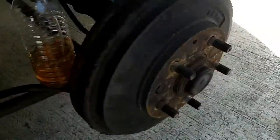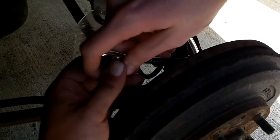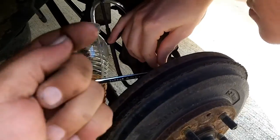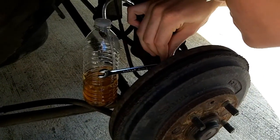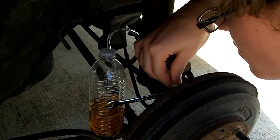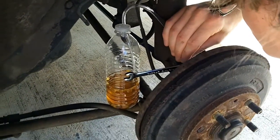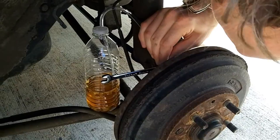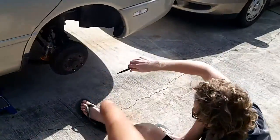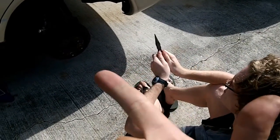The hardest part is getting the aquarium tubing on because it's not quite large enough, so you have to walk it on there and it does not want to go. That might take you a minute or two until you get it secure and airtight. Put the wrench on - when you crack it loose you're going to go up with it. The front bleeder valve is smaller than the rear, so Caleb took needle nose pliers and enlarged the tubing. It's plastic aquarium tubing.